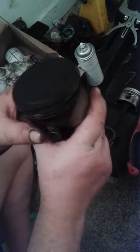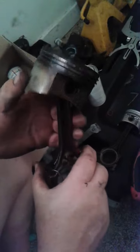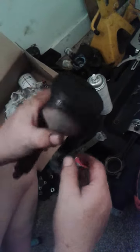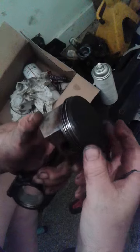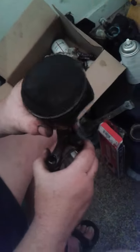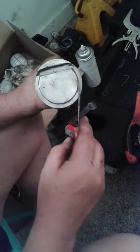That's quite a normal piston for the mileage of the vehicle. There is no play in the piston that is abnormal, so we're quite happy to reuse this. Once it's been cleaned and the old rings removed, we'll put brand new rings on there and everything will be good. You also need to check the crown for damage — the crown being the top of the piston.